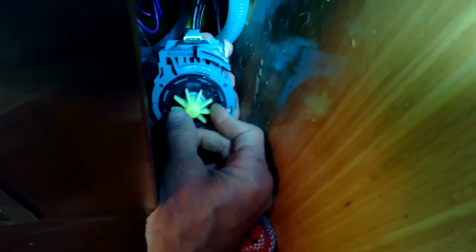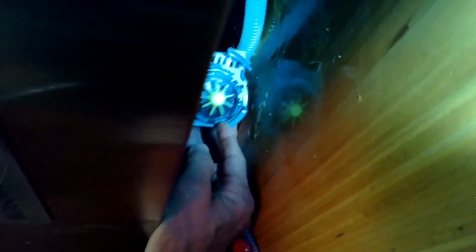And as soon as I pulled it out and I tried to turn it, it was jammed, and then a little piece of glass fell out, and that's really what was jamming it up. A little piece of the wine glass did find its way in and was blocking the impeller from moving. So here's what the little piece looks like. And that's very common. We find that often, or a little piece of ceramic or a seed gets past and blocks the impeller. And these pumps do come off pretty easily.